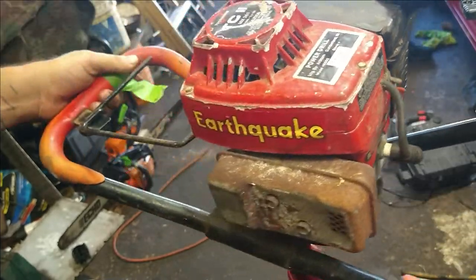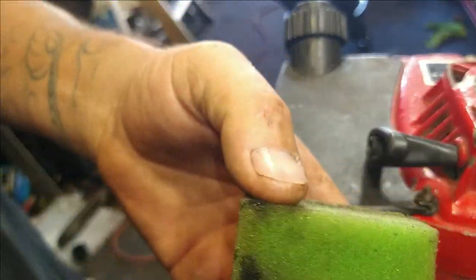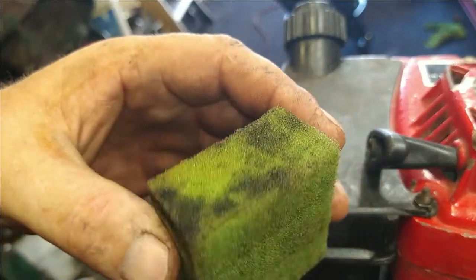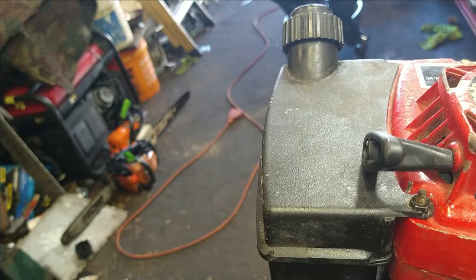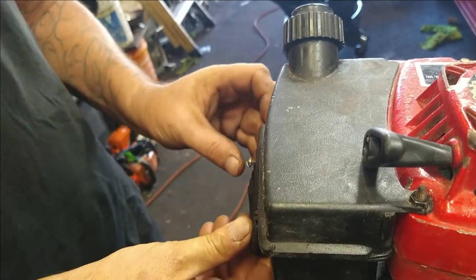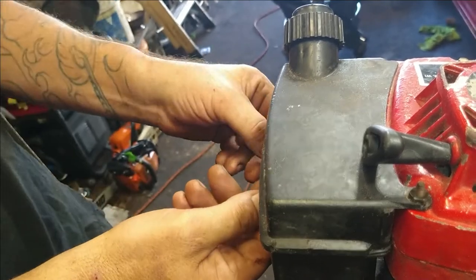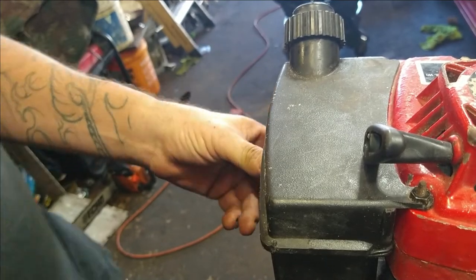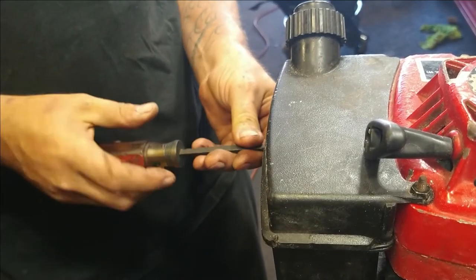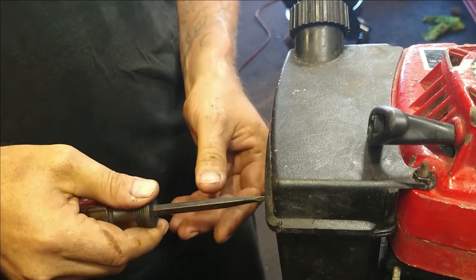That's it. We'll put the air filter back in — it's just a foam filter, not a big deal. I buy this in a sheet — you can get the generator foam filter, cut out your square, whatever you need, pop it in the air filter cover, pop it back on with two flat head screws. If this helped you out in any way, make sure you give me a thumbs up and hit that subscribe button. I'll put the carburetor and filter links in the description below — just click on the links and it'll take you right to them. If you want to do any advertising through my channel, message me.